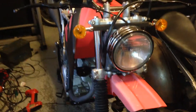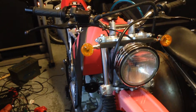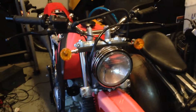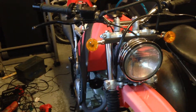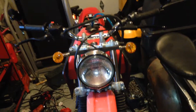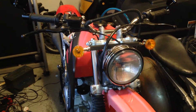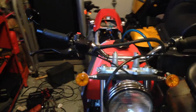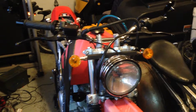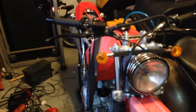I figured something with the battery was going awry. I did some testing with the bike running with the battery disconnected so the electricity from the charging system was going directly into the lighting system — and it was actually brighter that way. I was revving it and testing with my multimeter, but I was only getting about 6 volts DC output for some reason. And then it would spike so high that it actually blew out all the lights, even the LED taillight.